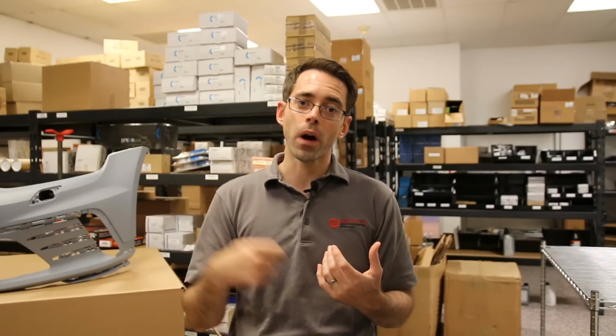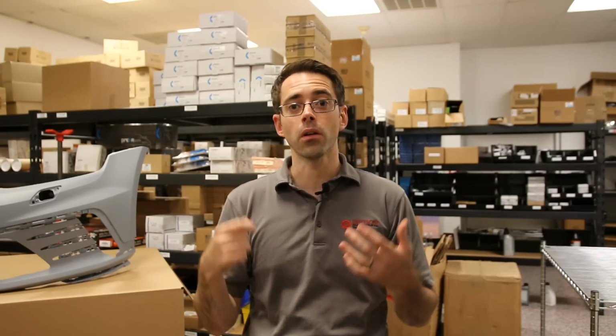If that's the case, you should inspect that stuff too to make sure you have good continuity and that there are no wires that are pulled out or connectors that are broken that aren't latching properly, all that type of stuff. That's always going to be the first way to go with this situation, because whenever you have faults that are related to something that you could have done to modify it, you should always first assume it's that, instead of assuming it's something else or that something's wrong with the car.